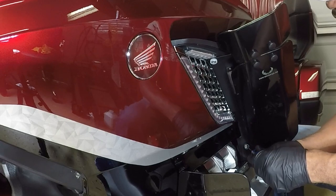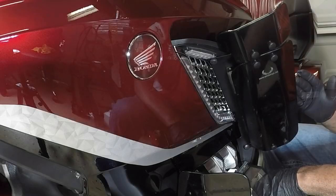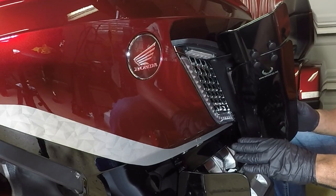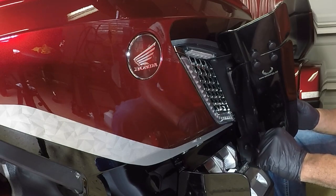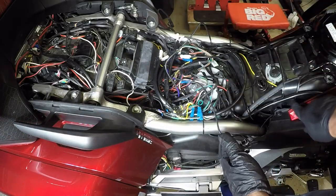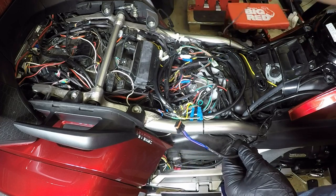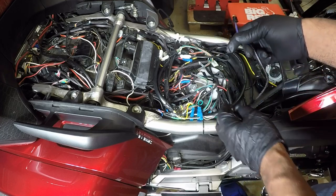So now I have the bolts tightened in. Now that I have the wind deflectors installed back on the Honda Goldwing, I have the side panels installed, and now we can go ahead and get the lights connected to the GOLDSTRIKE 48000 and turn on the panel lights. So now that I have the wires ran along the side of the bike on the left and the right side, here are the plugs. The next thing is connecting the panel lights to the wiring harness.